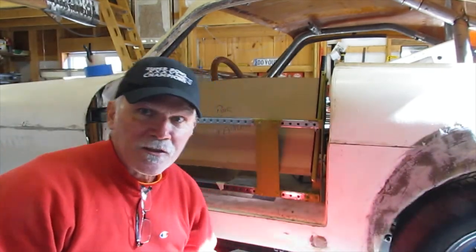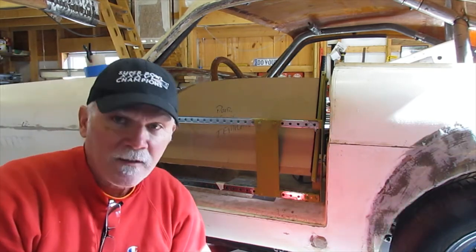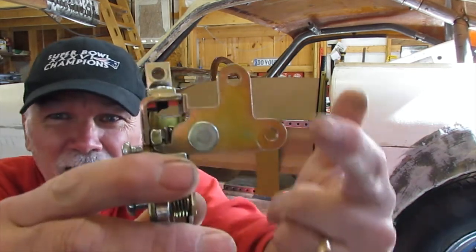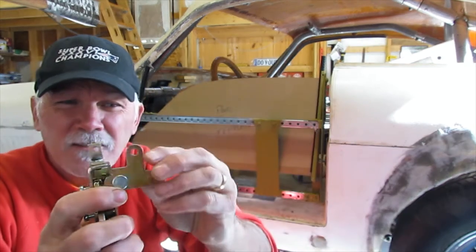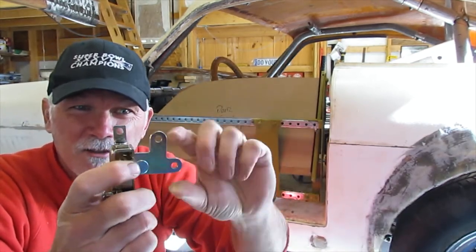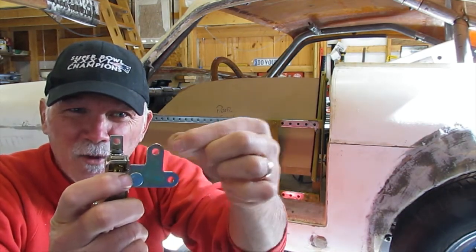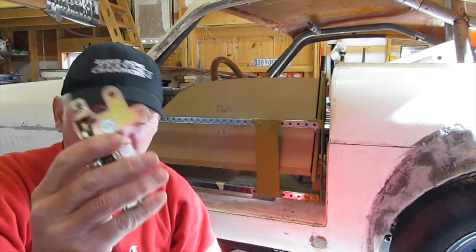Well, a clever little invention called a bell crank. Here's the door latch — this is the standard bear claw latch. What you see right here is known as a bell crank. What this does is it's a mechanical device that changes direction. If you pull down in this direction, then you have a motion in that direction. It all happens through a pivot. That's one bell crank.